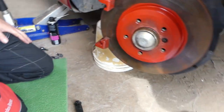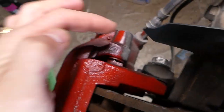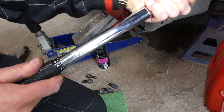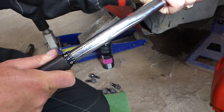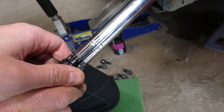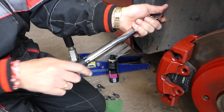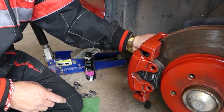Those pins — the glide pins — need to be at 30 newton meters, which is 22 foot pound, but double check all those numbers because it really could depend on the model and your conversion table. What we found for ours is that 30 newton meters works. Set the wrench to 30 newton meters, 22 foot pound, all the way up.